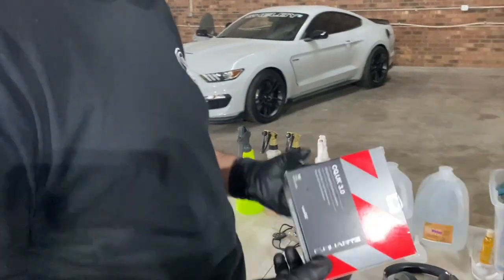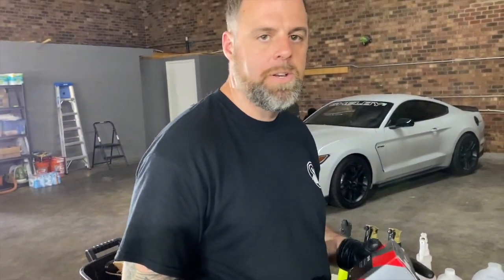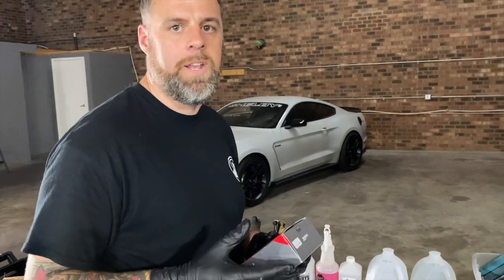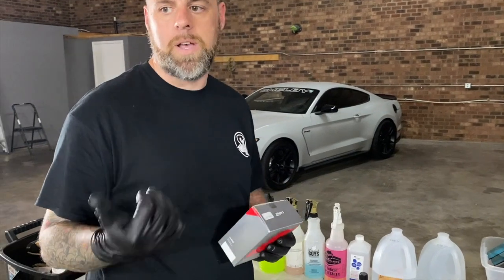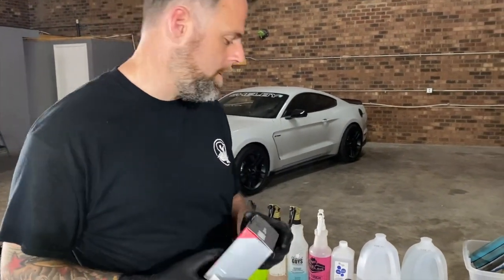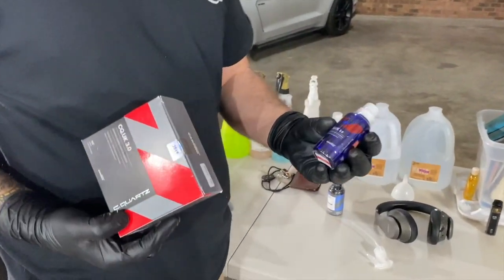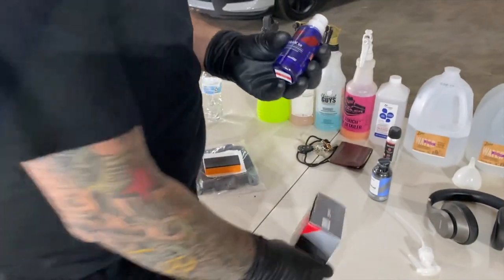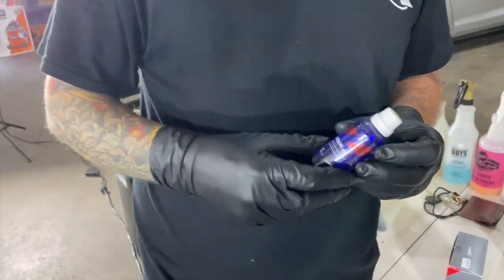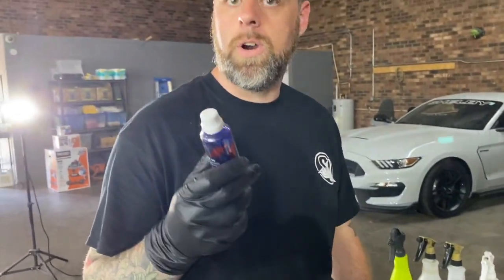It is a product that I started using early on in my career. It's honestly one of the strongest ones that a DIYer could do. It can be finicky in certain temperatures. Like if you're trying to do this outside, it's not a good idea, or like above 85 degrees. You just have to work quickly. If you buy the kit, it'll come with the bottle of ceramic. This bottle looks small, but you could probably do two layers on a car that this size. You could probably do two layers on a four-door average car, one layer on a big truck.